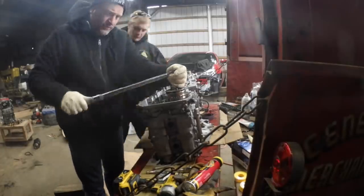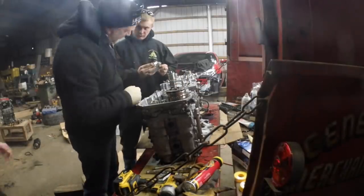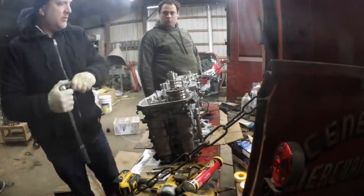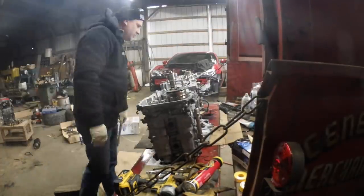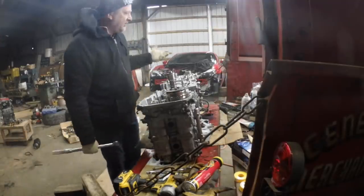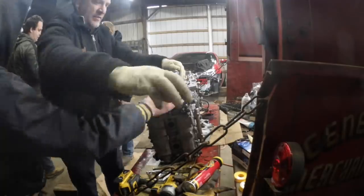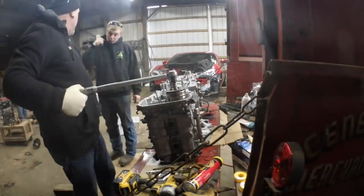That is your timing advance. There's oil pressure that goes into those things. It's not a 1940 Ford flathead V8 — or a '36 Ford flathead V8. Those are vacuum advance, whereas these are hydraulically advanced by using the engine oil.